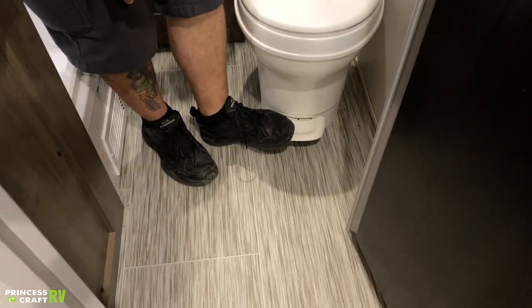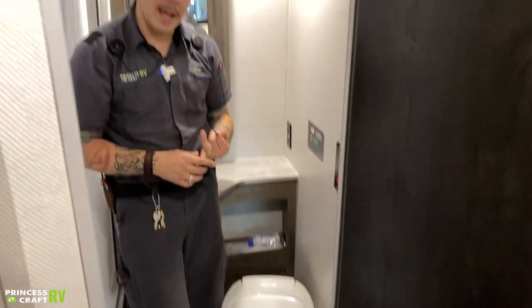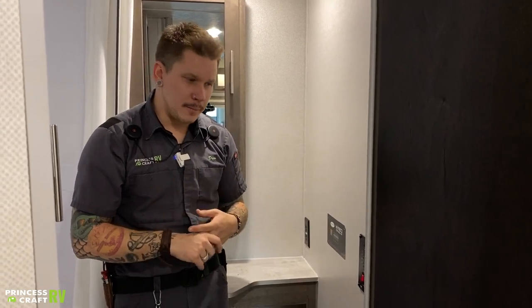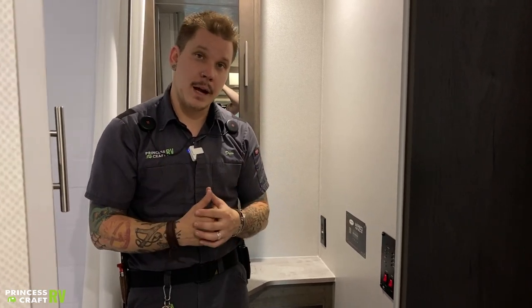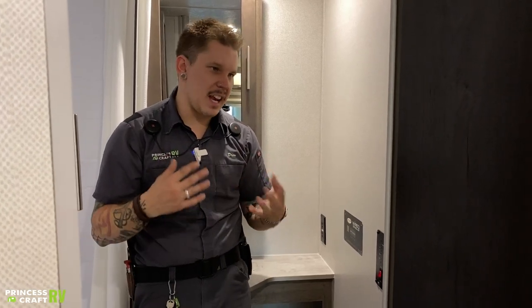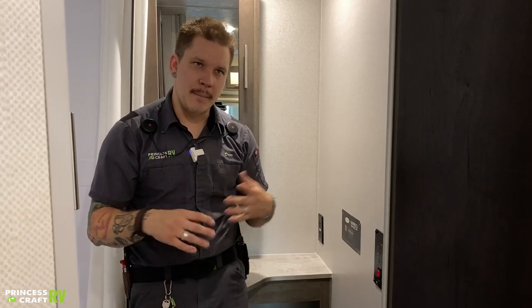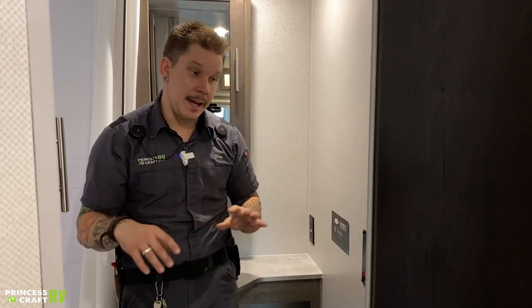Toilet flush is going to be a pedal — light press on the pedal to fill up the bowl with water, full press to flush. It's very important that we use a single-ply RV grade toilet paper as well as a deodorizing product and a tissue dissolver. You're going to introduce those products here directly at the toilet and chase them with a certain amount of water — that will be all you do while using the camper. Once you dump, you're going to kind of restart that process. My recommendation is that while you're storing the unit, you go ahead and store it with chemical in the tank. That's going to help really deodorize things while in storage, help break down any compounding that may be happening at the bottom of the tank, and while that's kind of sitting in the sun baking on, it's just going to keep things nice and fresh.